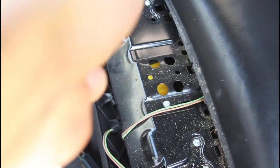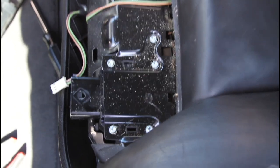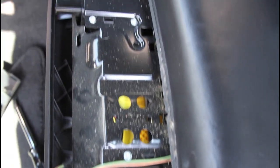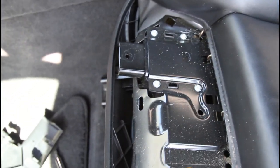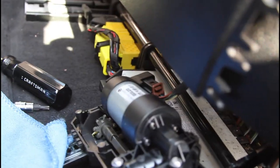Remove the plastic cover which covers it right over here — it's held in by two clips and there are two hinges in the back that clip in. You want to lift straight out like this, hinge it, and then pull it out. After you do that, remove all the T20 screws from the assembly and it will drop straight out. Once the whole assembly drops out, remove the red electrical connector and then take it straight out of the car to a workbench.